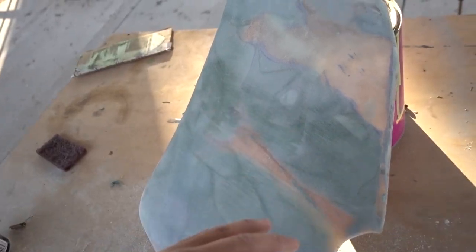So I got one piece of the bumper cover completely done. As for just bodywork, what seems like it's gonna be done, I think by today we might be able to get a set of primer onto here. The other one's still drying, but we're almost done with that one as well. But this one looks like it's almost completely done. Once I put the primer on, I'll be able to see any pinholes or anything like that, but the pinholes are gonna be a lot easier to fill in.